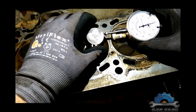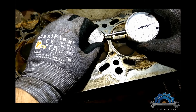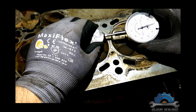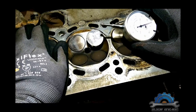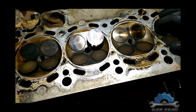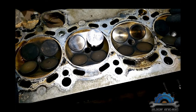To measure, put the valve in the open position, push it to one side, set the dial gauge, then push it the other way and read the difference. This one doesn't look too bad — it hasn't reached maximum wear. However, the exhaust side might be worse. On my M54 cylinder head I had to remove and replace the valve guides because one exhaust valve was leaking, causing a significant compression loss as well.